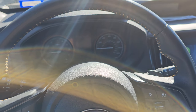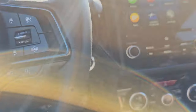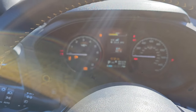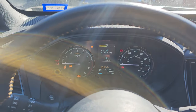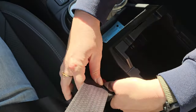To start, you're not going to put your foot on the brake at all. Go to the ignition start button and press it, then press it again — pressing it twice turns on all your accessories. From here you're going to have to be really quick because you need to click the driver's seatbelt button 20 times within 30 seconds.